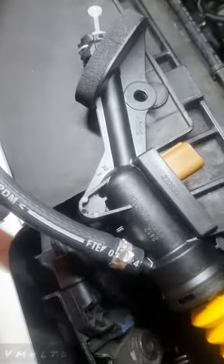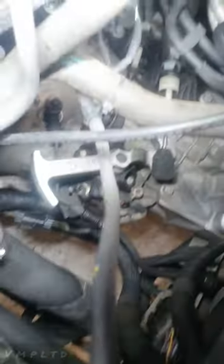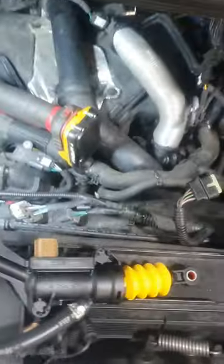The rest of it goes inside the gearbox. So yeah, you press the pedal, that sends the command to this, it obviously sends the brake fluid down towards the slave which then causes the release bearings and the clutch inside that gearbox to be released, then you can change gear. If you've lost that function it's gonna be either one of the two, so you literally follow the residue, you follow the trace of brake fluid. The slave and surrounding parts is totally dry and the master was totally wet.